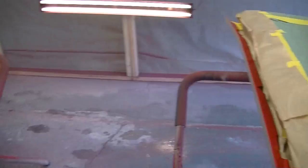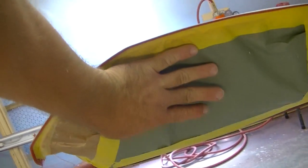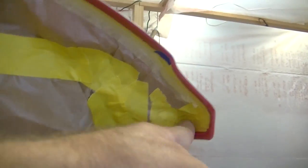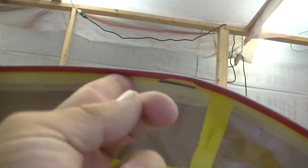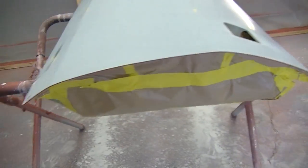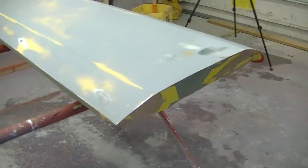So now we're ready to spray — well, first wet sand. We will wet sand these outer shells as we flip these doors and then spray. Getting ready to put a coat of sealer on and then a coat of color after that. We've got to push down this tape, especially on these door ends — the hinge side and the open side. That open side is crucial. You want to make sure you're opening up that tape nice and tight back against there because it was folded. I don't know the tricks of taping to prevent that bending. If you know it, shoot me feedback, because I use half inch tape and I'm still having issues with it rolling back.